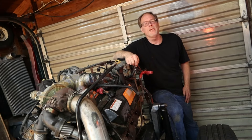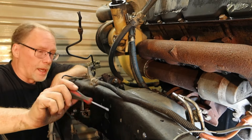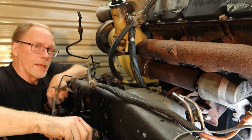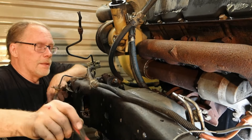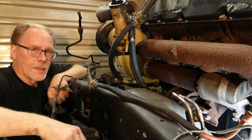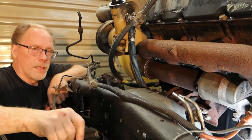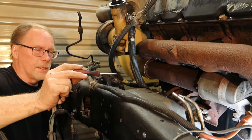What we're talking about is the oil cooler. This right here takes oil from the low pressure oil pump, feeds it through, goes through the oil filter and up into the motor. The whole concept is: when the engine is cold it helps heat up the oil, and when the engine is hot and under load it cools the oil down so it doesn't boil off and turn to tar.